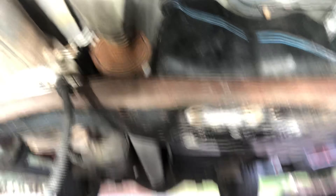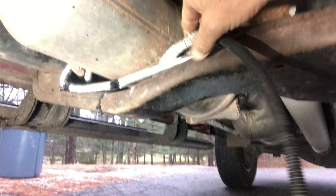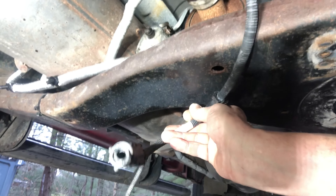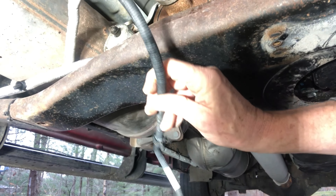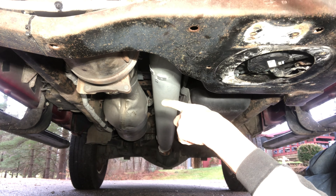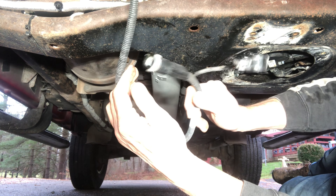That's probably the major things you had to do, other than route the new hose around — which I'm still in the process of doing. Here's the new hose, here's the old hose. As I go around, I'll just set the clips — unclip the old hose, clip in the new hose — until you get all the way over to your injector, where there's a connector that goes on there, a 90-degree angle connector, but no wiring harness on that side. Found out this wiring harness just feeds a heating element that goes through this tubing, which keeps the DEF fluid from freezing — going from the pump over to the injector. The connector on the injector has nothing to do with this heater hose; the only electrical connector is at the front end, at the pump connection.